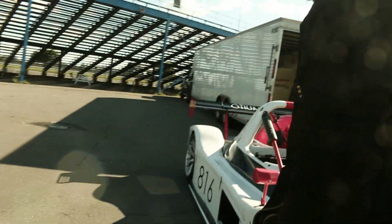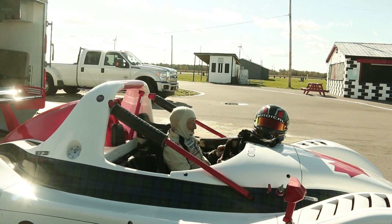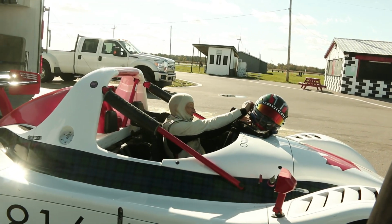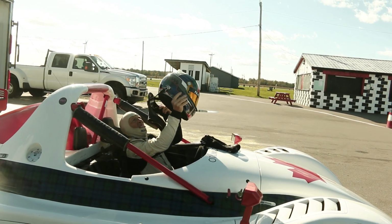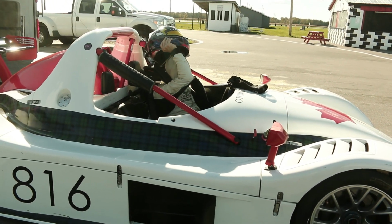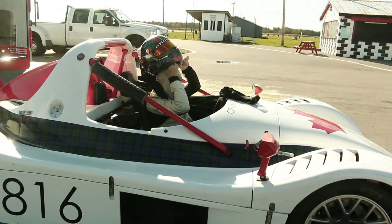And like, what's the weight of the car? So the weight for these cars, dry, is usually around 1,300 pounds. For a racing series, it should be close to around 1,565 is the minimum weight that you can have in the car. Okay, with driver and fuel? Yeah, all that. So, yeah, if you think Mossport, top speed is around 200k, and then coming through turn 8, you don't lift. You just go flat out. Yeah. Wow. So these cars have a lot of downforce. I think they produce around maybe 300 kilograms of downforce at top speed.